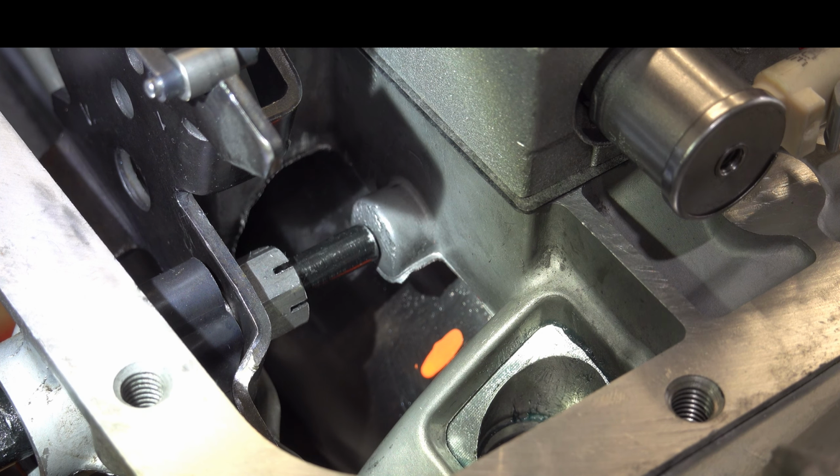We're going to assume we have a slight flare on the 3-2 and a late harsh 1-2 upshift. Otherwise, if we only had a late harsh 1-2 upshift, it could very well be P1870, the regulator and isolator valve for the torque converter in the valve body being worn, which is very common, especially in the 95 to 2000 4L60Es. We could also assume there's a broken 1-2 accumulator outer spring in the housing. Let's assume we check that just to do our due diligence, and we found that the springs are both intact and in good shape, with no issues with the piston.